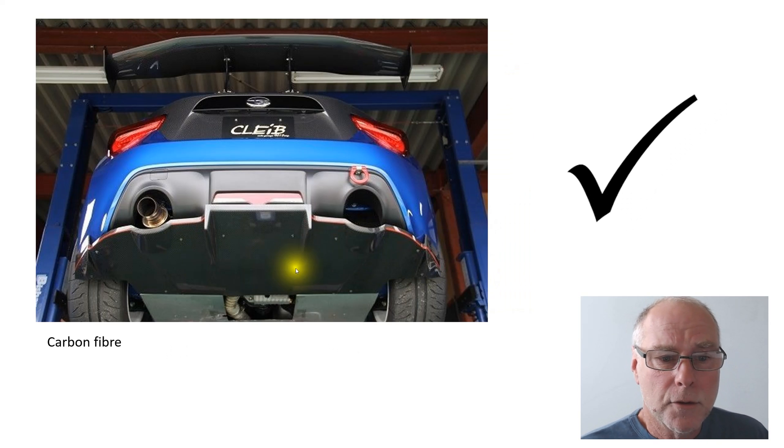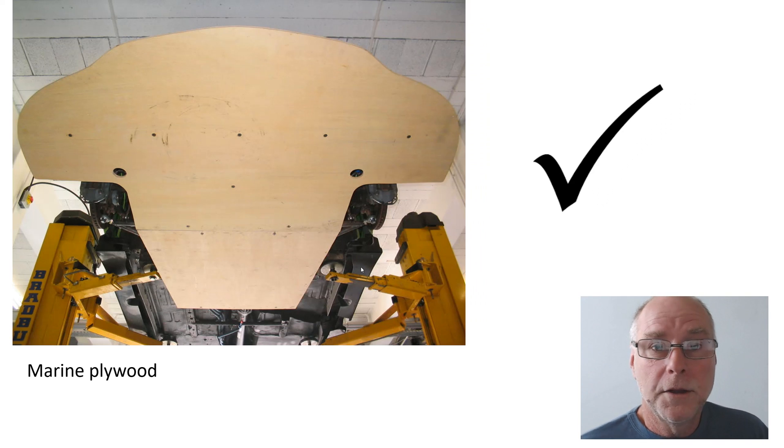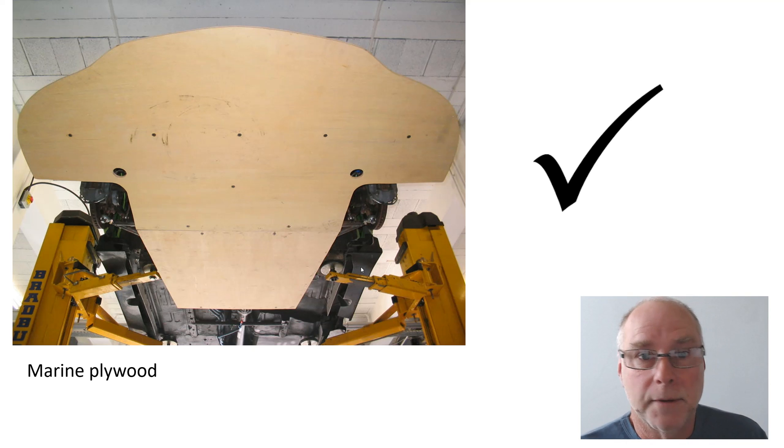Or if you want to get really fancy, you can use carbon fibre — very stiff and very light — but for a one-off it's typically too much work. Don't forget though, you can buy a pre-made flat carbon fibre sheet that's reasonably cheap and still quite light. Or you can use marine plywood. People tend to turn their nose up at this, but marine plywood — not normal plywood which falls apart when wet — uses waterproof glue, is quite stiff, relatively light, and you can cut it with normal woodworking tools. It's also quite resilient if scraped on the ground or hit by rocks.